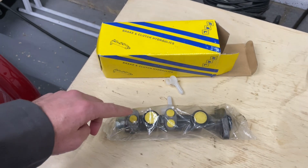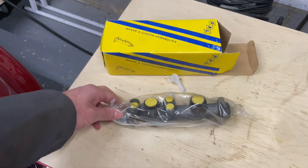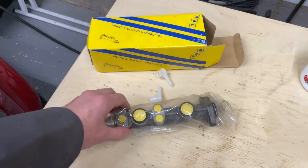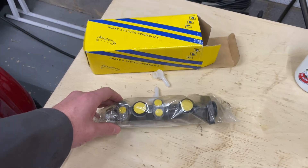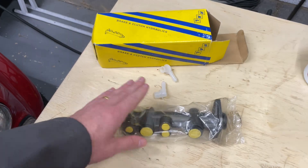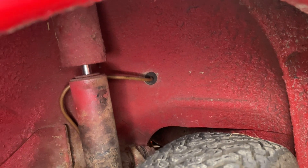You've got the two connections up front going to your front brakes, and this one going to your rear brake. There are a couple of reasons to do the upgrade, especially if you've got disc brakes. Because it's two-chamber, if one fails you've still got braking. Secondly, it produces more force, so you get better braking with this dual cylinder setup.